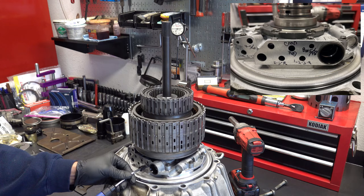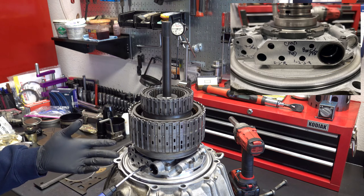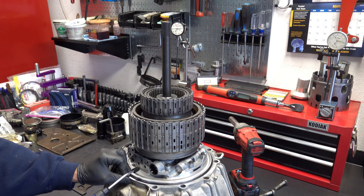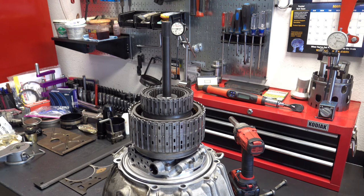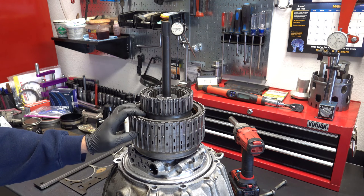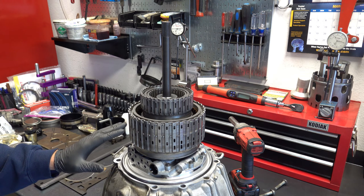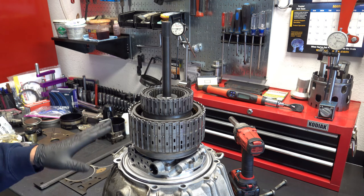So what we're looking for is a very robust apply, no hissing, and then a nice abrupt release once we cut off the air source. All right — 80,000 mile old lip seals, everything is good. We have no instances of hissing coming from deep inside this drum. That's what you want to hear. You don't want to hear any kind of hissing.